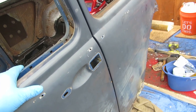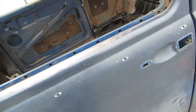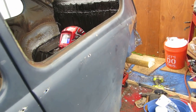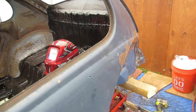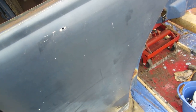So you've got about a 24-hour window for your urethane base before it's done, before the solvent's cooked off of it, and you can't spray any clear into it. Well, you can spray it on it, but it won't meld into it like it should, and you'll have problems with the clear coming off. So you have about a 24-hour window.